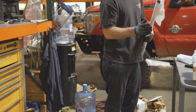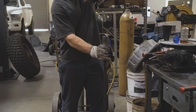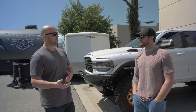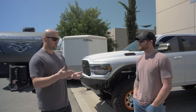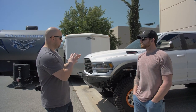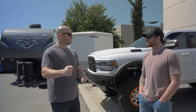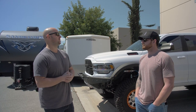What we also did up front was add the torsion sway bar. It replaces the immobile factory sway bar that only allows as much deflection as the bushings will deflect — so you hit a manhole cover on the left and you're going to feel it shake the whole chassis. It replaces that with an actual torsion spring that engages progressively. You have a little float zone, and then as that one tire leans or drops, you get active rate engagement resisting it. With your new 3.0 King shocks keeping everything planted, where lean in a factory truck gets super sketchy, this just pushes you to try for more, knowing the rear end isn't going to slip out. You've got more traction as you dig in.